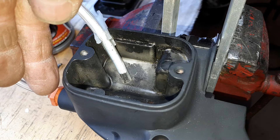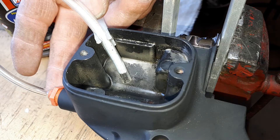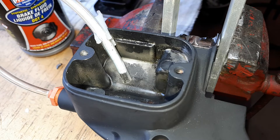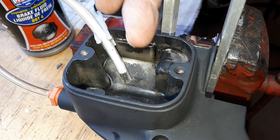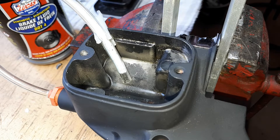I've got this little rig set up here in the outlet port — this is just a brake master cylinder bleeding kit. You usually get it if you buy a master cylinder for a car, but it's basically a fitting and a plastic tube that's going to simply recirculate the fluid back in. I'm going to fill it up with brake fluid — DOT 4 is recommended for this machine.